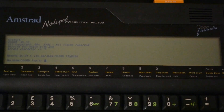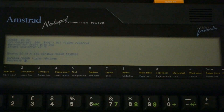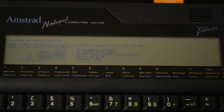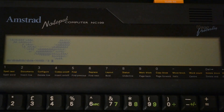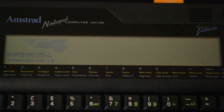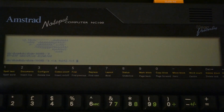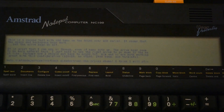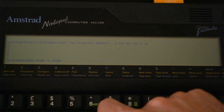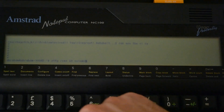And just like that, we see my Ubuntu login prompt appear on the screen. I should set VT100 emulation and you can see that beautiful screenfetch there with all the important details about my ASUS EEPC. Now there are some limitations — I have this set up with the ZCN termcap which is not completely VT100 compatible. The arrow keys don't seem to work so I am limited using VIM, for example. Fortunately, tab works. After I log in I need to do STTY rows 10 columns 120.